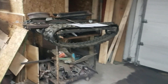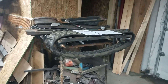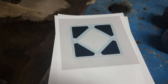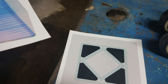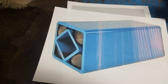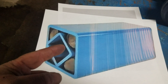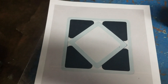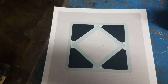There's the severely neglected frame and track. We left off last time talking about that stuff and now we're down to the suspension. If you recall, my goal has been to make some sort of a torsion suspension. You have to watch my other videos — subscribe or look back — and this is kind of what we were looking at: square tubing, another square tubing inside, simple rubber cord. There's one looking from the end with a rubber cord that's really pushed in there, and that would be a lot stiffer.